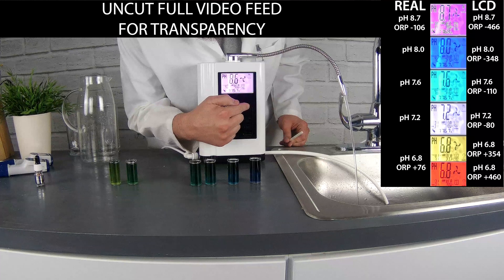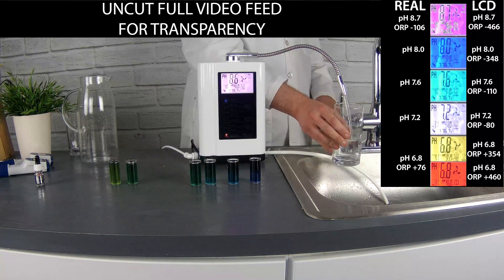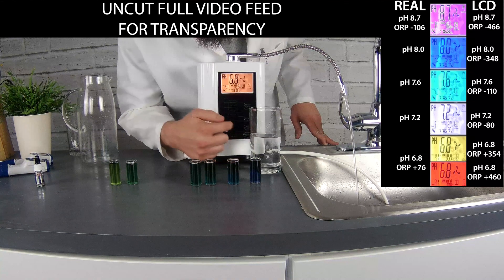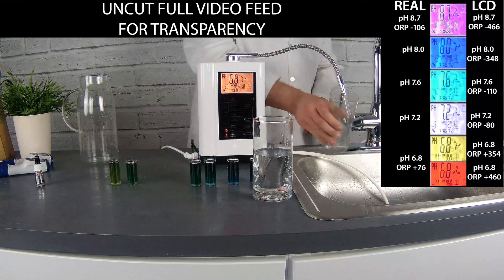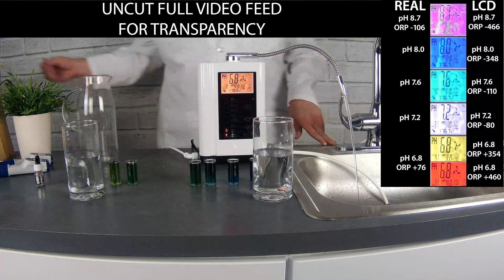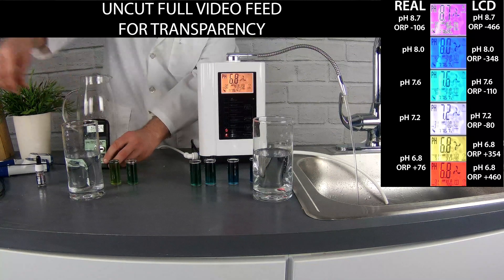The part we're really interested in now is the ORP — the minimum and the maximum ORP. Right now we're on the highest setting. We let the machine run for a little bit to make sure we're getting fresh water, and we're also filling up a bigger glass for ORP testing. What happens a lot of times is the little tiny bubbles in the water will actually form over the ORP tester and give an inaccurate reading. So when you test ORP you want to make sure you have a lot of volume of water and you need to shake the end of the meter a little bit so there are no bubbles forming.